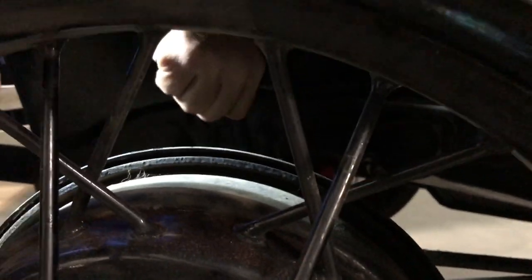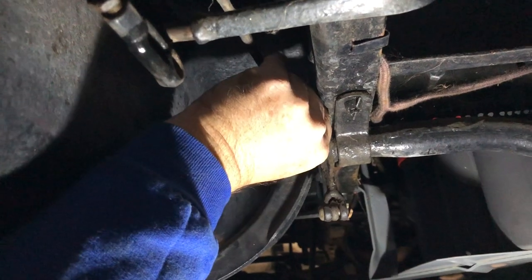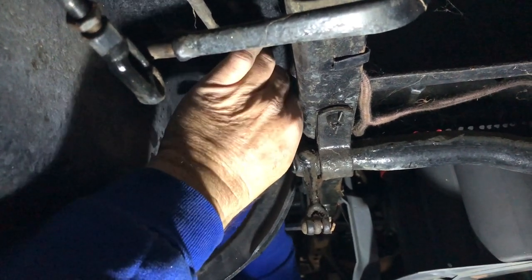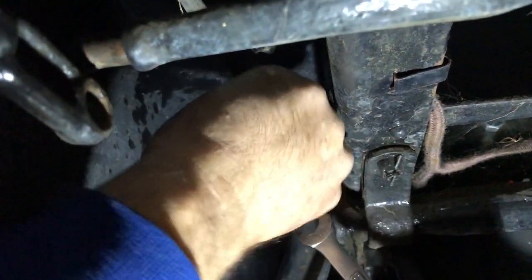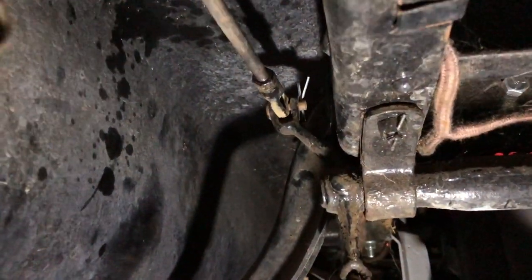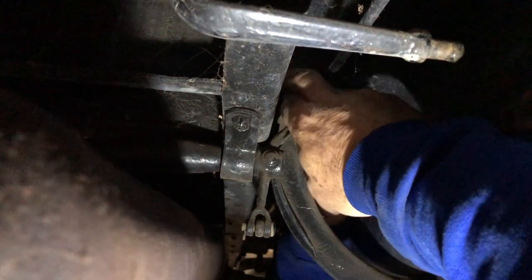I'm just going to put these in kind of temporary because I don't know if I'm going to have to make more adjustments after we drive it. There we go — cotter pin in. I'll bend the cotter pin in such a way that it doesn't come out. Jam nut against the clevis. I sprayed some juice on this earlier so they're moving fairly easily. Done. Now let's do the driver's side rear brake — put the cotter pin in and spin it around so I can bend it so it doesn't come out, because you don't know if you're going to have to make another adjustment or not.